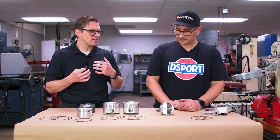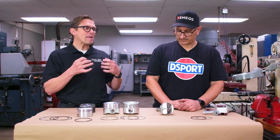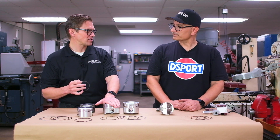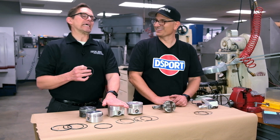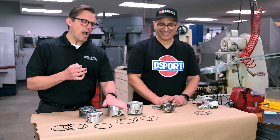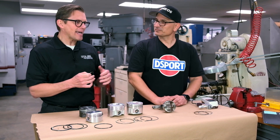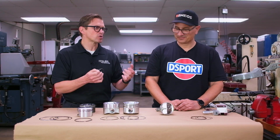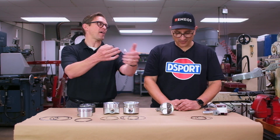When that hard anodizing makes the surface rougher, it can't seal as well. From our NASCAR days at Joe Gibbs Racing, we actually made the most power with un-anodized ring grooves. But longevity was the challenge — you had to get the engine to break in before going to the racetrack. You didn't want to wear the rings out, so you were trying to run the engine really hard really soon to break it in and make sure you had the most power at the racetrack.